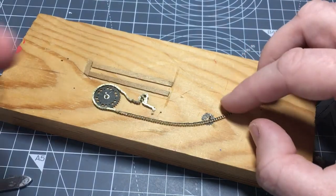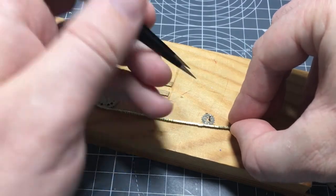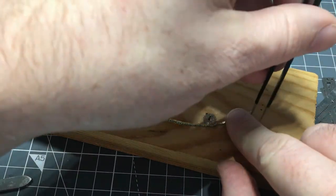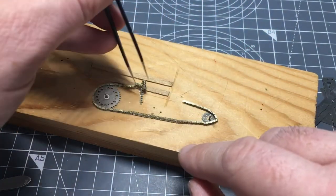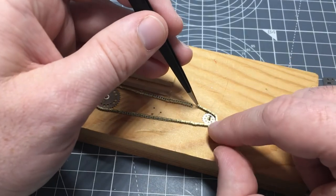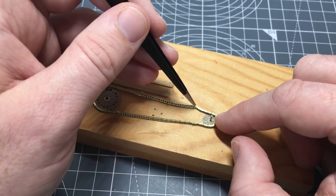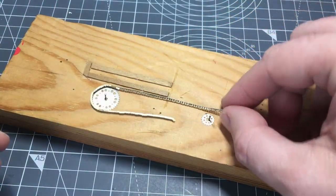Let's come off that one. Could do with a spacer or something underneath these sprockets to make up for the links, but I haven't got anything, so what you get if I wrap that round there, I'll just do it loose for now, just so you get the idea, is you can see that the link will be the right size there for that chain. So once it's fitted to the bike and it's actually wrapped around the sprockets properly on the bike, that's the right length chain. And then obviously it will be working, as you can see, like that, going around there, and it'll go around the front one as well.